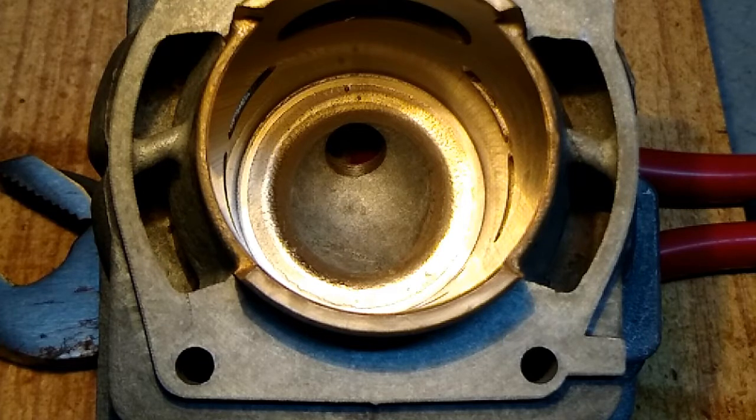It's going up kind of cone-shaped toward the center of the cylinder, and I'm wanting to flatten that out and if at all possible maybe even widen it. I don't have a jig set up for my lathe to hold it and go in with a boring bar, and I don't have a milling machine. So the only way I can deal with this is a mandrel I've made, just shy of three thousandths of the cylinder, using sandpaper to level out the squish band. It's going to cost me in some aspects — it's going to help me on my intake duration if I'm successful.